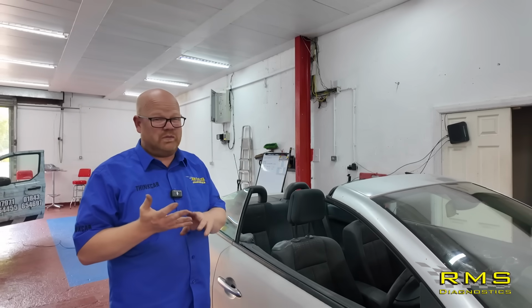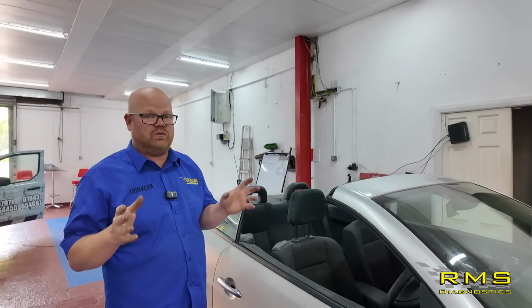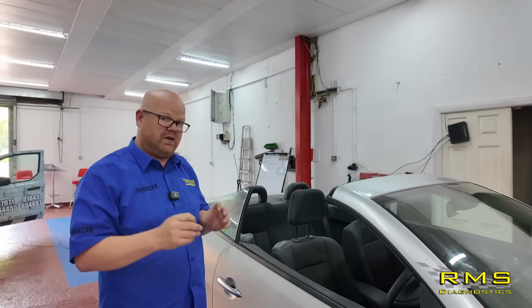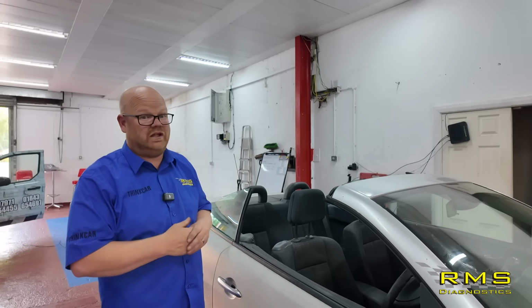The amount of people that could have gone live, switched live to the module, ordered another module, and he hadn't load tested it. So don't forget, load it up with a bulb, 5-watt bulb, maybe a 10-watt bulb as well. Most wires in cars will carry about a 10-watt bulb. So yeah, just put one of them on it, see if it drops away while you've got your multimeter connected. Might stop you ordering any incorrect parts.